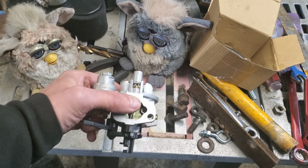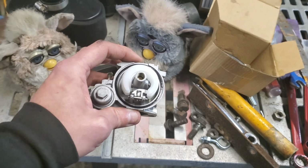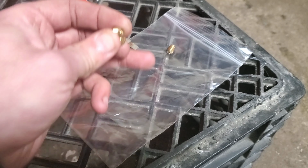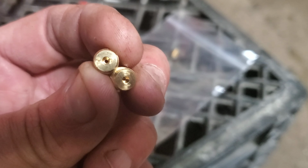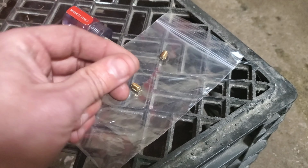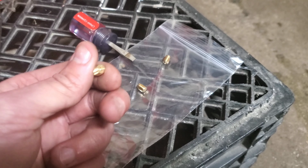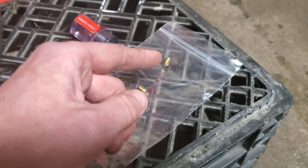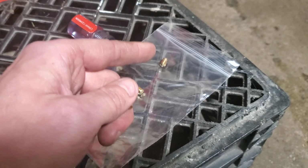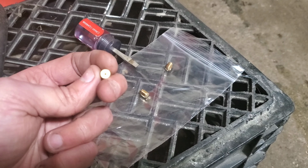Unfortunately, with the ethanol gas we've got going on, these tend to get corroded. So you're a lot better off doing this kind of tuning on a brand new carburetor than dealing with an old one. There we are, we got our stock one out. We got our shiny brand new ones here. We've got a 41 and a 42. We're going to take the 41 and put that in first. I'll post a link for these in the description in case you need some. We're going to keep our stock one because eventually, if we keep upgrading the motor, we're going to need bigger jets, and we might as well get a small drill bit and drill that out to get to the next size up.